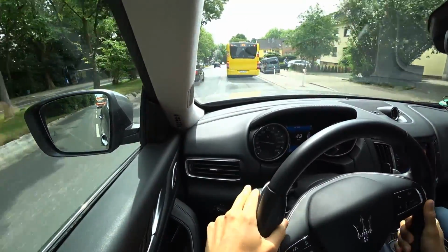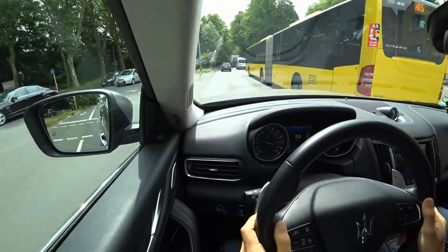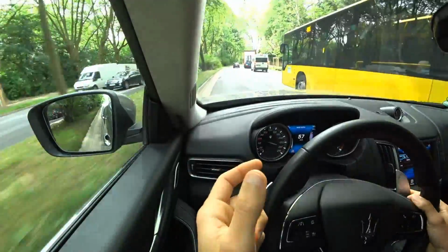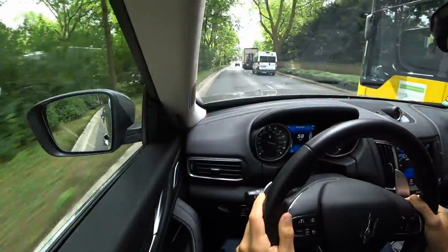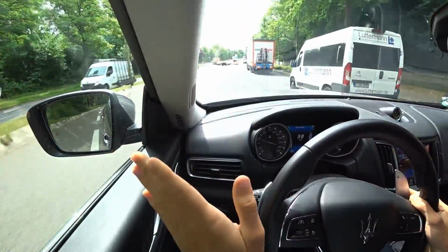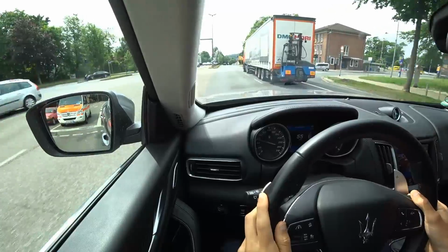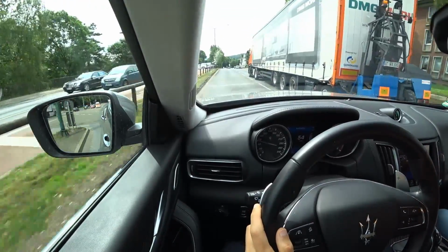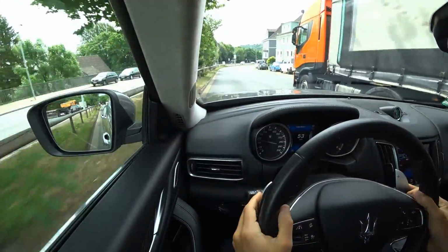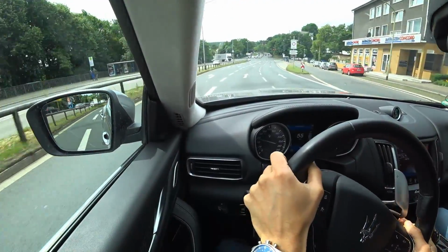It is something in between. For example, with a Volkswagen Tiguan or an Audi Q7, in the Volkswagen AG, all the vehicles have pretty early reaction times. Also Mercedes, for example, really early, before the car is appearing somewhere. With the Peugeot 3008, we had it that it only flashes when the car is basically directly next to you, which doesn't make too much sense. Here, it's really just flashing when the car is directly in your blind spot. That is one approach. I, however, think it's still better when you already know when a car is approaching, because sometimes the car is so fast that at the time you really want to switch lanes, it's already in the blind spot.